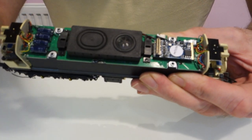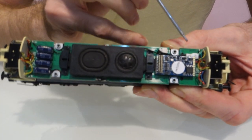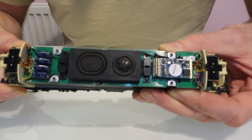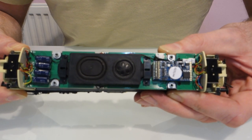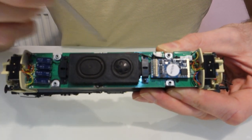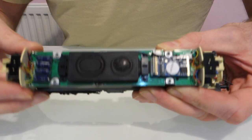You take all six of those screws out and the circuit board lifts off, and then underneath the circuit board there's a little black box which is your sugar cube speaker, which is just held on with two screws. So you can simply just take it off and then basically put it all back together. Your other speaker is still connected through the plug here so that all still works as it should.